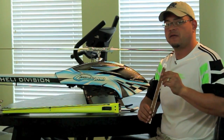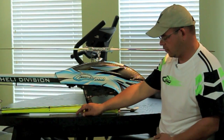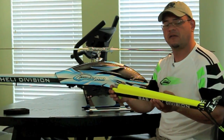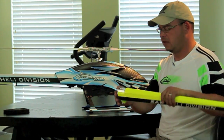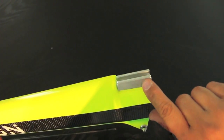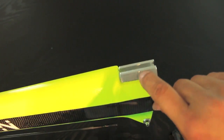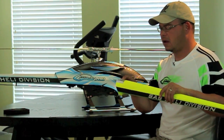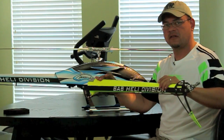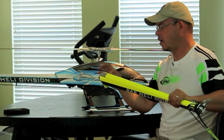If you're not reading 145 millimeters, then there's a clearance issue. What we've discovered at SAB is that on some booms from the very first batch, the incidence on the little metal plate that mounts the boom into the helicopter is a little bit off. Keep in mind that 0.2 of a millimeter angle on this plate pretty much turns into 10 millimeters or even more at the back.